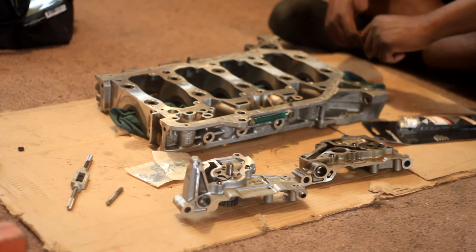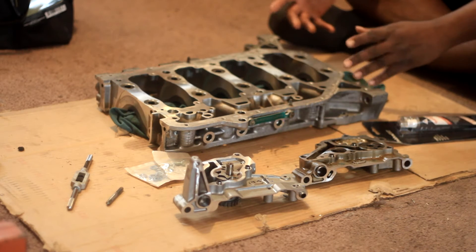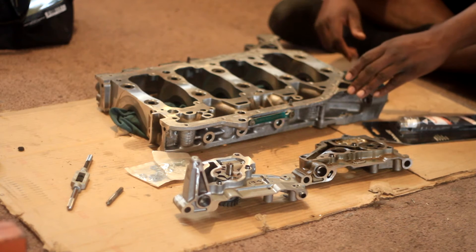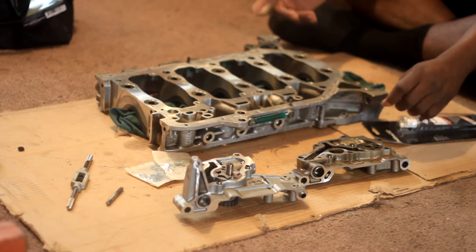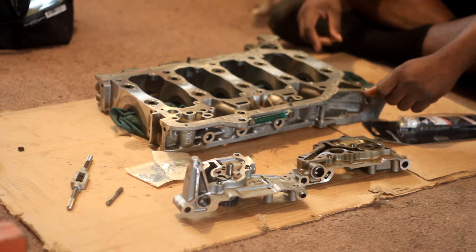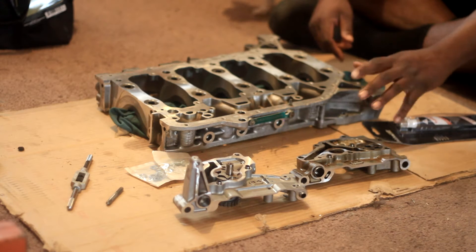With the balance shaft, the oil pump is heavier — it's a really big, heavy setup. I can tell you myself, I have them and it's heavy. The shaft that is spinning the oil is not driven directly by the crankshaft, so it's probably spinning a bit faster than crankshaft speed. Speed is increased, cavitation is increased, and it probably won't be safe to be revving that high with this big setup.